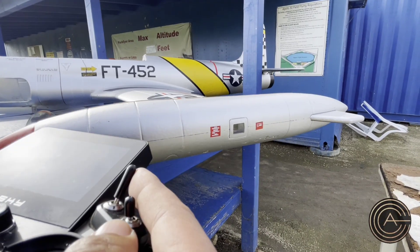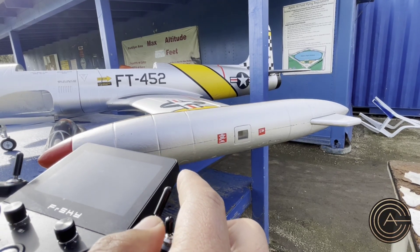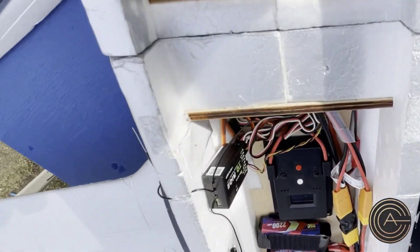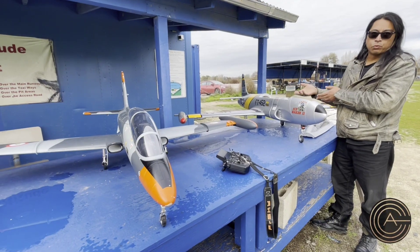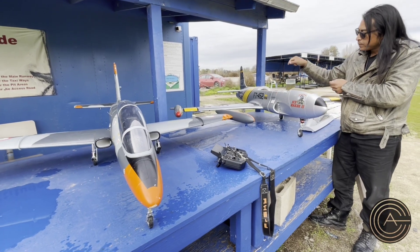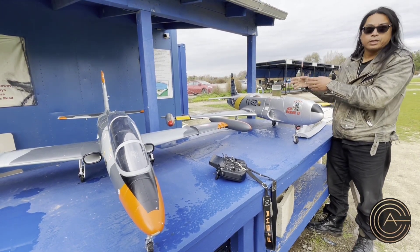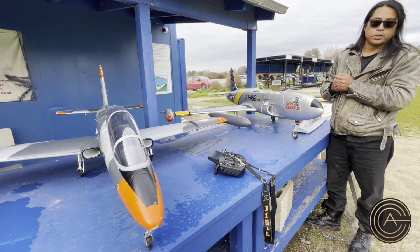The lights also go into the MFC, so I can assign lights to a channel and turn them on and off. The only thing I did differently on this one is I put the AG63 gyro in here. Because of that, I have to bypass the brake controller built into the MFC and use the AG63 as a brake controller, so the wiring is not as clean.